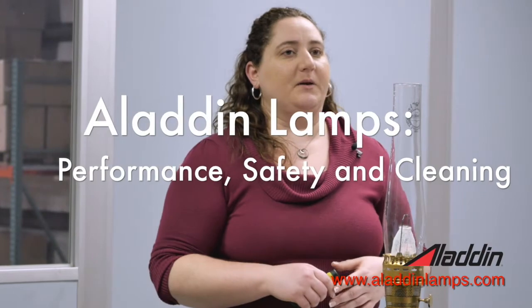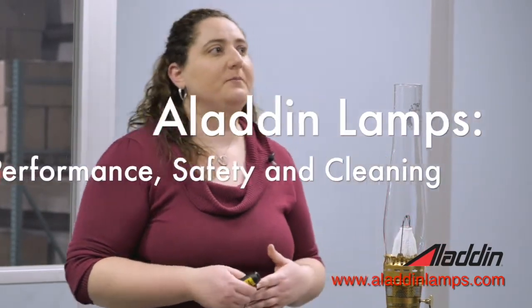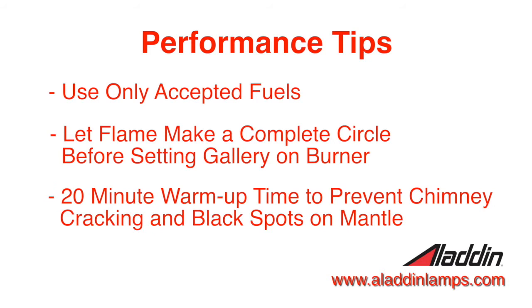So we're going to talk a little bit about performance tips, what to do to get the most out of your lamp. So the first thing would be using only acceptable fuels, Aladdin lamp oil, kerosene being the best options. One thing when you're lighting it, to make sure that you let your flame go the entire way around your wick before you set the gallery on top. The 20-minute warm-up time, very important to remember that so that you don't crack your chimney, to prevent those black spots from showing up on your mantle.